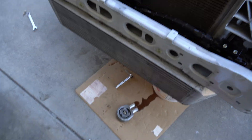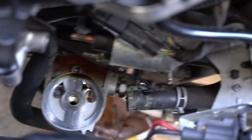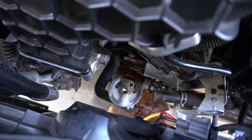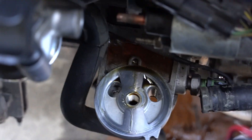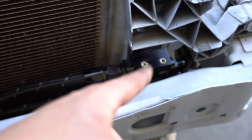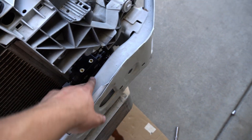We finally got that thing off after about three hours of struggle. You have to move all this stuff out of the way just to get your starter connectors off, and then get to the lines down there, which are oriented completely differently than your hand can reach. Probably one of the harder installs I've done — it's just a bunch of nonsense. I still had to cut the line, clean this up, and put the new bracket on for the AN lines that route around to there. Hard to film when you can't get anything done.